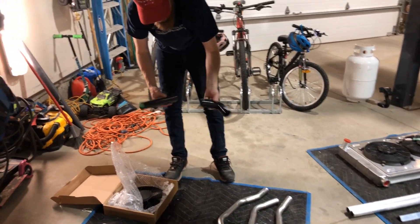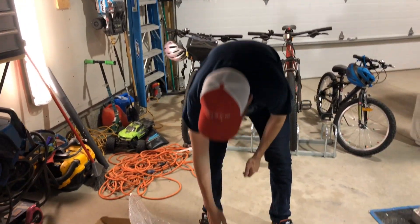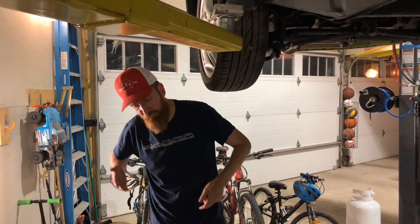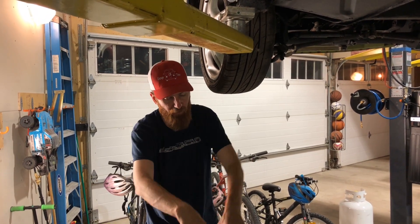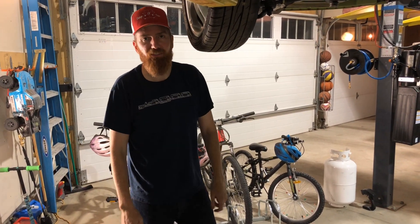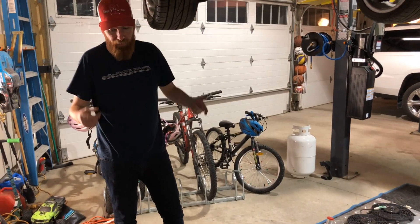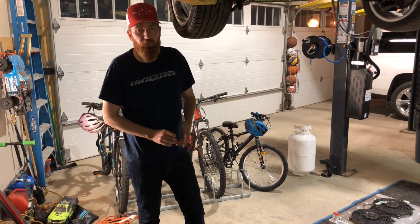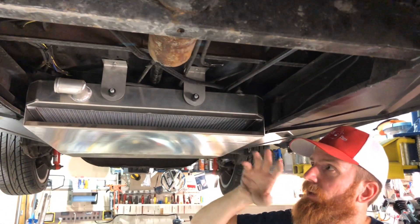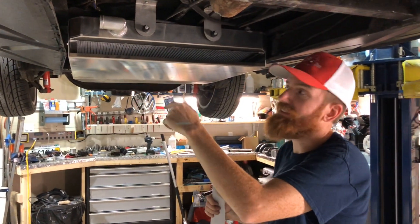It came with beautiful hoses. I still have to mount the fans — they're going to be on the underside as puller fans, because you have the scoop at the bottom ramming air in as you go down the highway. The fans are just helping pull that air through, so you have the force of driving plus the fans pulling. When you're at a stoplight you're relying on the fans just to suck air through. We're going to go ahead and get this mocked up. The radiator is hanging by itself in the car right now, some of it on self-tapping screws, but it's hanging.